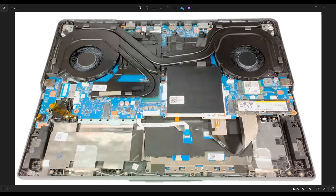Much like a solid state drive, this plugs into the port and has a single screw holding it down, and you'll see the antenna wire coming down here. The antenna wires are just snaps — not plugs — so you can just snap those right up and off of that board. Then undo that single screw and you can slide the Wi-Fi card out from that port.